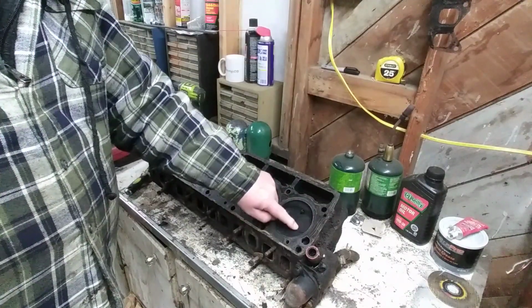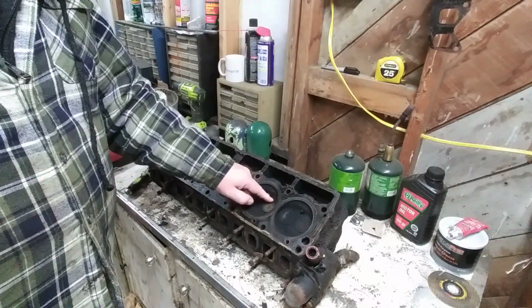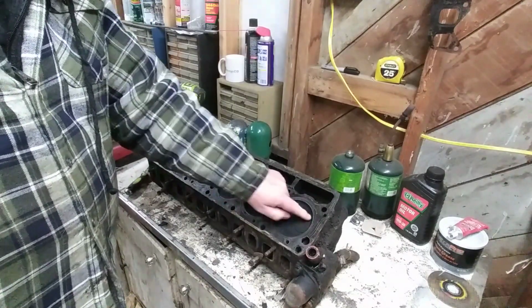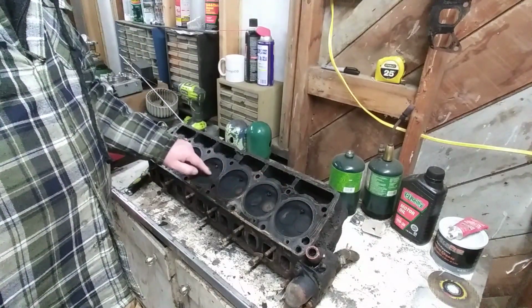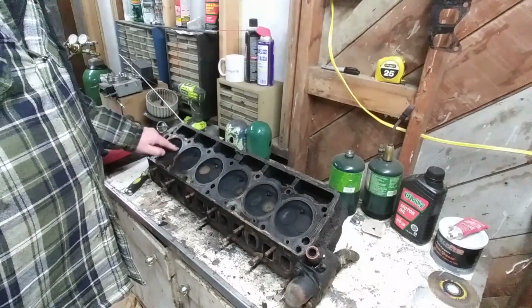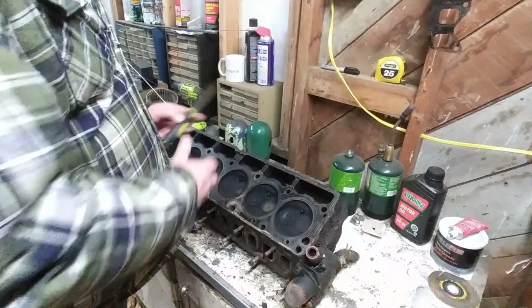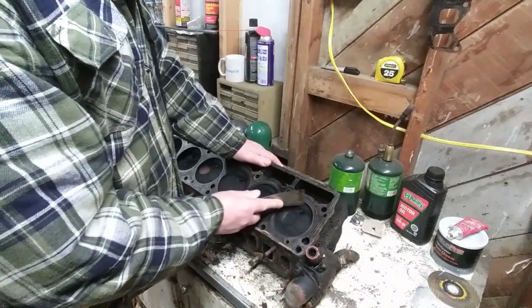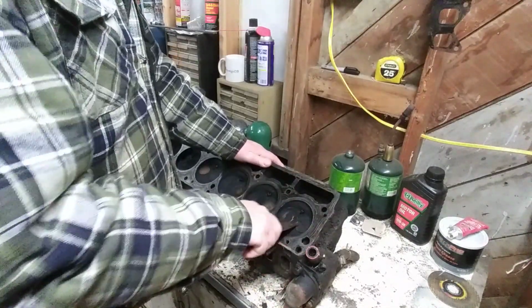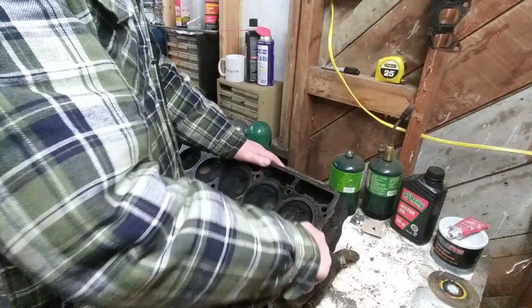There's also kind of recess in the valves. They should be flat to the surface. They should be a little raised above. They're not, so they've been recessed a little bit. It's probably a good candidate for putting new seats and stuff in it. Take a look at the valves. Look at the cylinder head, this chamber, a little bit.